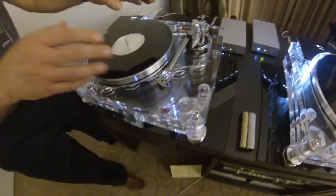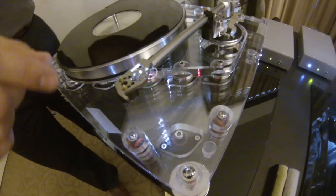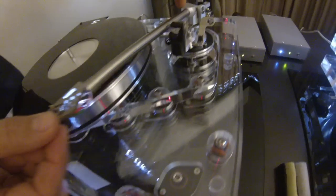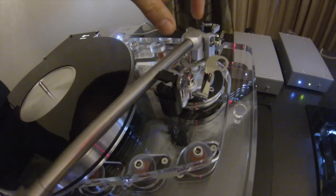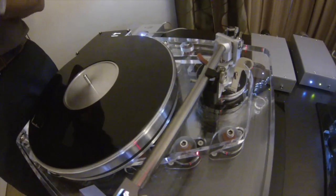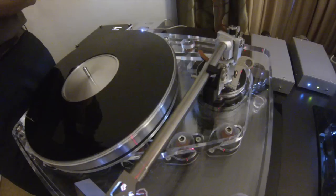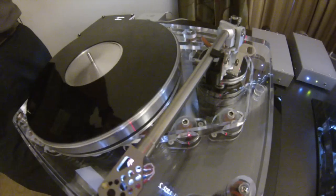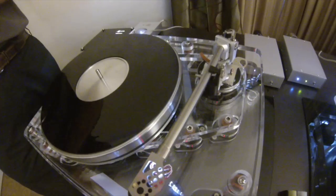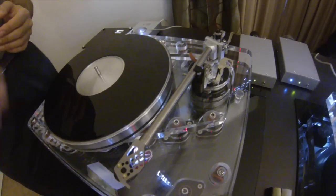The tone arm was done first, as you know, because I seriously thought the weakest link was the tone arm. There are several materials and things used, but geometrically it has a pivot point in the horizontal direction which is about an inch above the pivot point for the vertical direction. This is mainly to do with the low frequency cut that is lateral and mono, and as it goes up it becomes stereo. So for the tone arm to be stable at the low frequency cut sideways, which always changes the harmonic structure above, even if you don't have systems that go very low, sometimes you play things and think timing isn't quite good, but if you go to a system that goes low, you hear all those very low notes coming. They're the ones that are upsetting the tone arm.